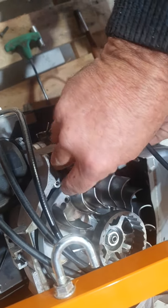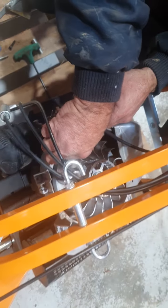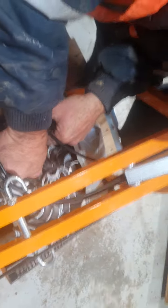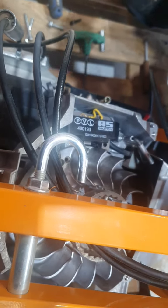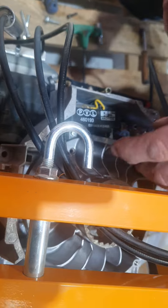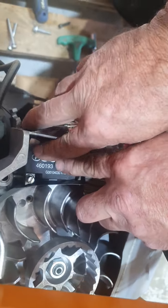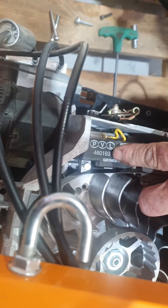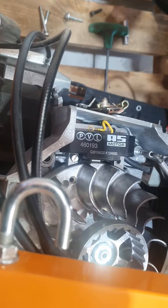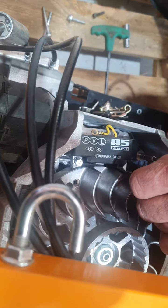Feed your wire back in, put your gauge in between, push that back up, and retighten on both sides. Use the feeler gauge on both sides and lock them in place — 0.2 to 0.3mm feeler gauge.